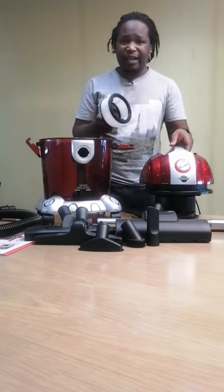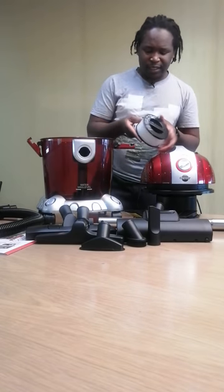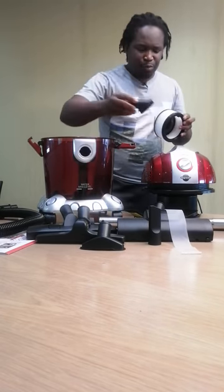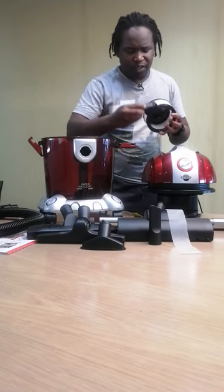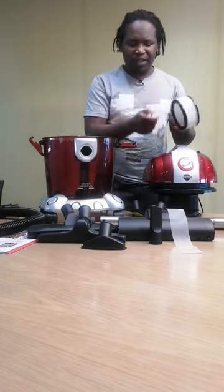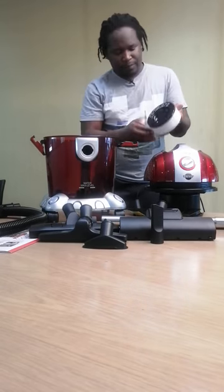This is the only filter that comes out that you need to take care of. I've seen people using it for over two years. Most people will recommend you wash it, some recommend you dust it. The manual says: you do wash this filter, but not as often as you have to dust it — focus on dusting it. When you dust it, you've got this mesh here. You can take the non-scratch brush and go in between to loosen all the dust, then tap it down or use the blower — because this machine has a blower — and just blow that dust out. It removes it. This is called the mesh, and this is the filter you'll have to take care of.